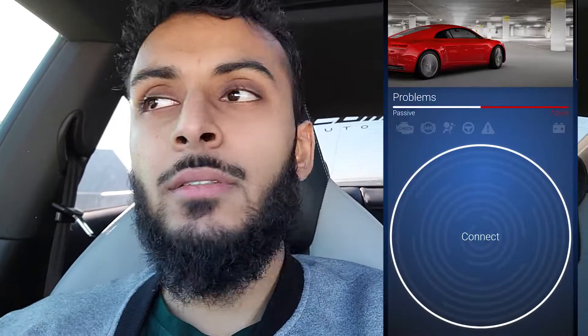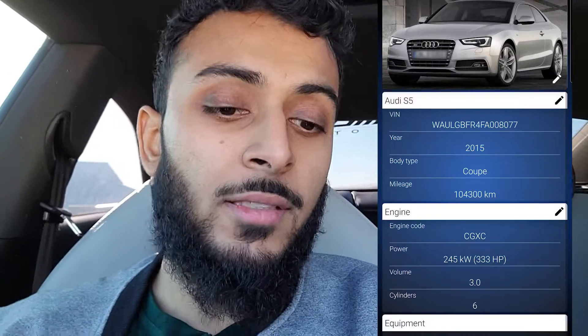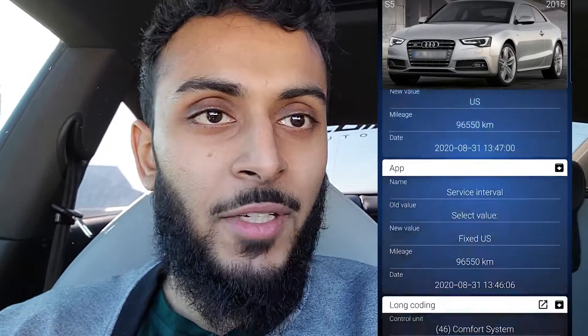This car does have the Bang & Olufsen sound system. On my car the right side speakers don't actually work — I have a component protection issue. Audi, BMW, Mercedes — all these German manufacturers have a lot of coding in their cars, so everything is coded in. I don't think the actual speakers are bad because I did swap them and they still didn't work. I have to take it to either a dealer or someone with ODIS software — it's Audi branded software — and they might be able to deal with the component protection. Using VCDS I wasn't able to figure it out. I also have OBD11, which is an OBD2 plug that helps you access the computer and do a few changes yourself.